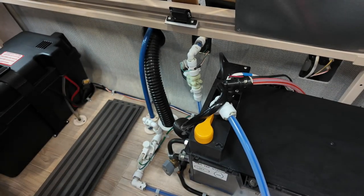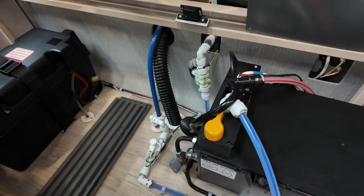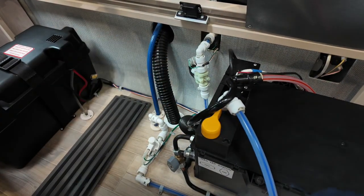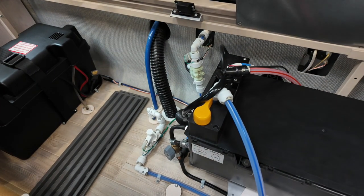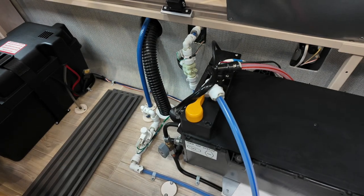Alternatively, the water in there can go stagnant if you're not coming back to it for a few months, mainly if it's going to storage. So when you're using the van, when you aren't using the van, it's really important to drain that off, winterization, storing it. You just don't want the boiler pipes freezing and cracking, that's all.